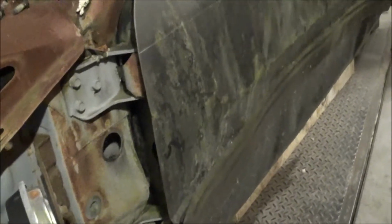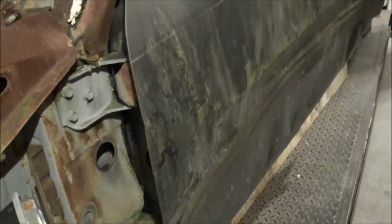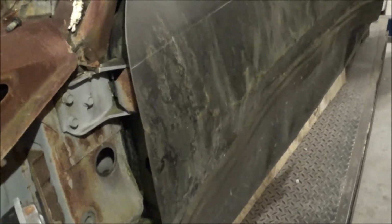The first thing to do is get in here and just take this door off, because this one doesn't even have hinges. So what we're going to have to do is grind these pins out. These pins right here, I don't have a set of aftermarket pins, but I can grind these out and reuse them, no problem. Then put these hinges on that door, and then get everything swapped over. So let's get busy with that and see what we can accomplish.